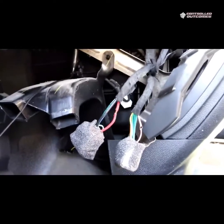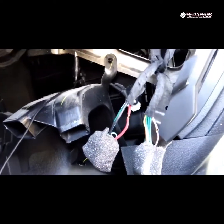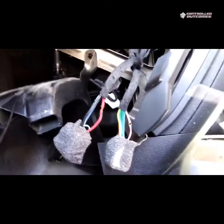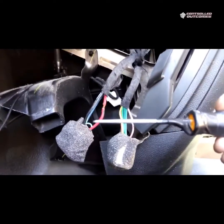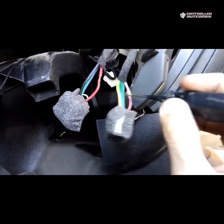How you do your poking wraps is you'll start with just your bare wire. You'll take your strippers to the right diameter of that wire, and you're going to pull that sleeve back just a little bit and expose that metal. You're then going to take a poker like this. You're going to then stick that through the wire and create a hole.